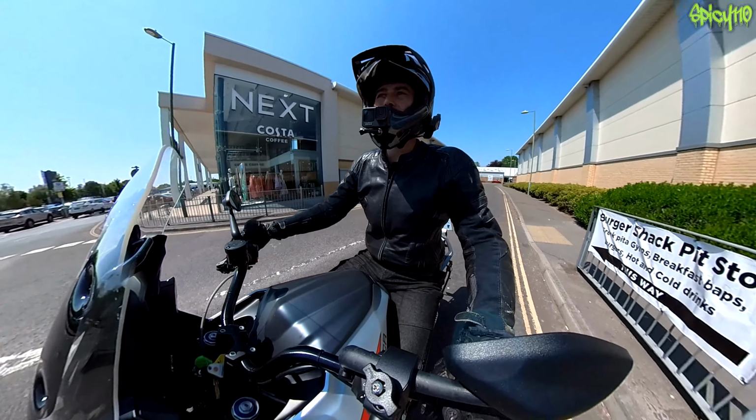Coming down the bike, the battery is in this part here. We've got the motor here, which is absolutely massive, and this says danger, high voltage, contact may cause electrical shock or burn. When something's got a big danger warning on it, you know it's a good thing. Rear brake is here, pegs, this is all very nicely made stuff. Brembo rear brake with a 280 disc on the back and a two-pot piston caliper from the looks of it. Pillion pegs down here. This rack on the back is to do with the luggage, and I have a whole video on the luggage of its own. So I mean, there's so many things with this bike. Trellis frame up here, you can see the danger orange snakes through there.